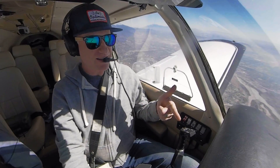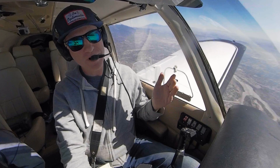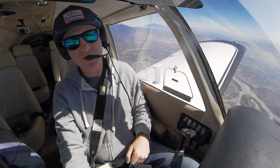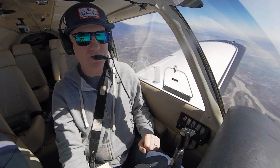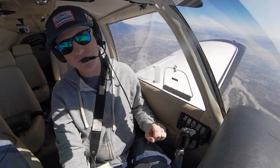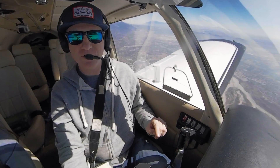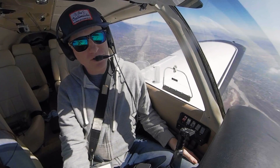As you can see, the SkyView will control the TrueTrack in true heading mode, and the bugs for altitude and vertical speed will control the TrueTrack. So if you really want to fly heading and you don't want to use the TrueTrack head control unit to control the Autopilot in track mode, you can use the Dynon HDX to control heading.